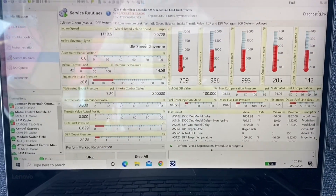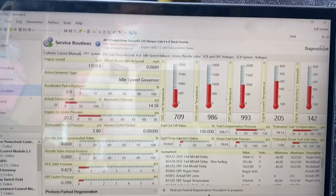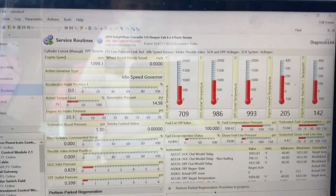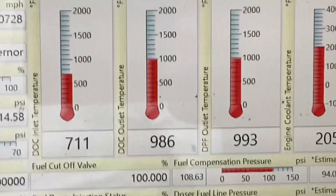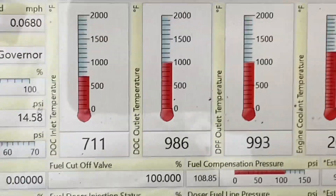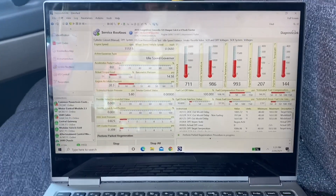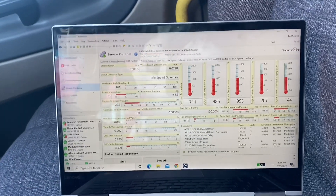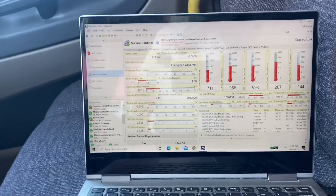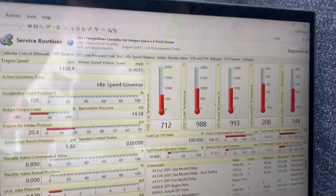So we are about 15, maybe 20 minutes in — probably a little closer to 15. These are our temperatures right now, which seem to be pretty steady. The first time I did this, it literally shot up to 1,200 degrees right there on the DPF outlet temp. Right now the temperatures look pretty good. We're only about 15 minutes in. I want this to go through the entire regen process — this will take about 30 to maybe 40 minutes depending on how dirty the filter is. Right now the DPFs are actually at level zero, or zone zero, so that's good. Pressures look pretty good. Temperatures look good.